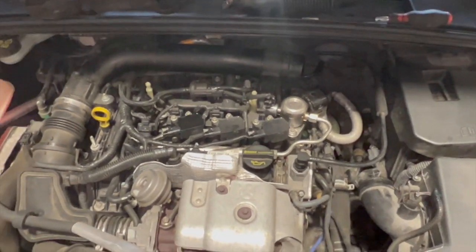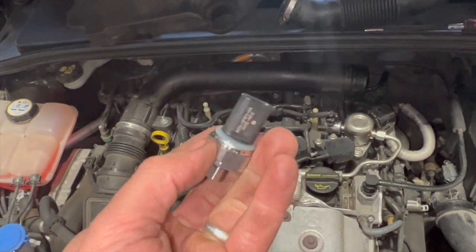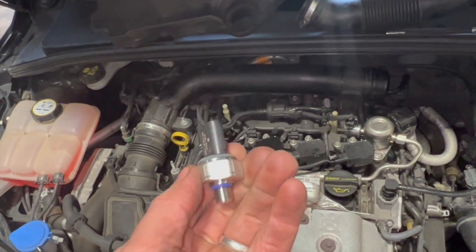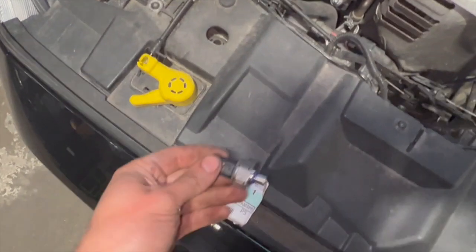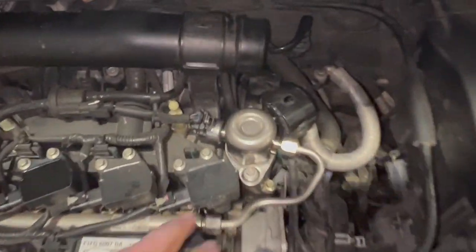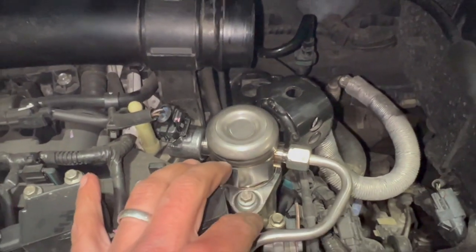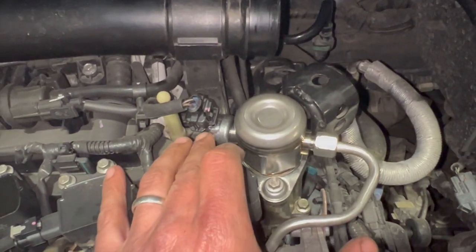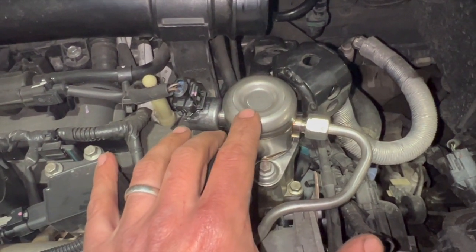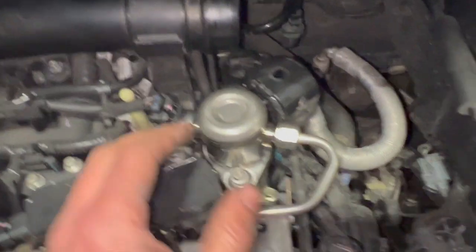Now that's out of the way we can see everything under the collar a bit better. I'll show you the sensor we're going to replace to fix the fault — it's the low pressure fuel sensor. You can only get these from Ford at the minute; I've put links in the description below to where you can get it. We've also got the high pressure fuel pump here — these are quite a common issue, they come with the regulators built in, and I think you can get some aftermarket ones now, links in the description for those as well.